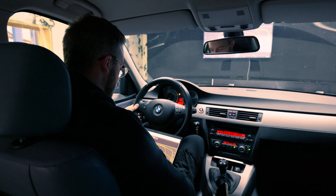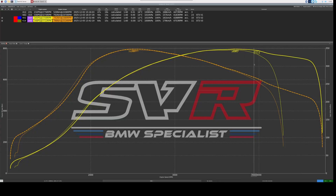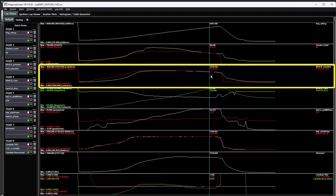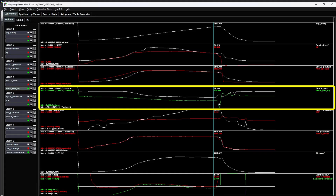That's not too bad — we made 796 Newton meters at 348 HP. You can see the boost taper a bit on top as well. Boost is quite controlled and stable, nothing to say about it. We have 588 degrees Celsius in the downpipe at the end of the run, which is quite low. Lambda is 1.10–1.09 right before the limiter, so not too smoky. The fuel pump still has some room, so not limited. Even when it spools and gets on torque, rail pressure stays stable. This is a good base — around 1100 kilograms of air per hour, which is not too bad for a turbo like this.